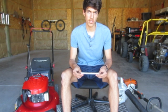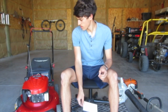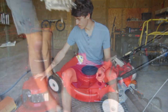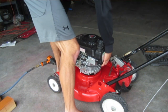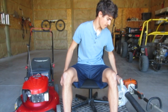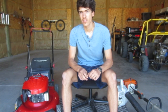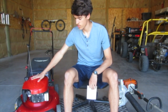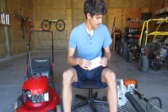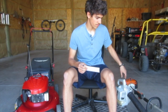The first thing we're going to talk about is weight. Four-strokes weigh more — they just do. Two-strokes, especially these small ones, are way lighter. A Briggs Quantum like this is almost 30 pounds from what I've researched. So it makes sense to put a heavier engine on a lawnmower with wheels, and to put the lighter two-stroke in stuff you're going to have to carry around.